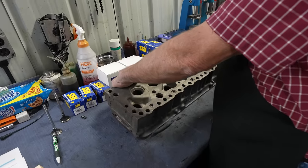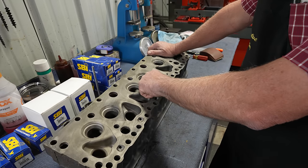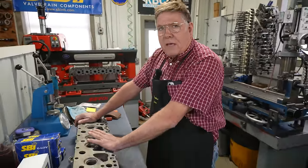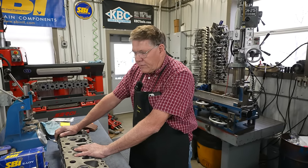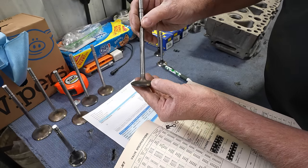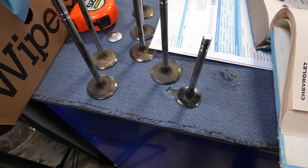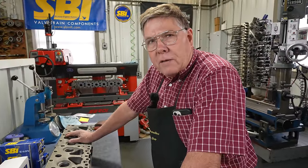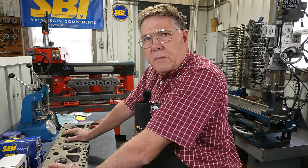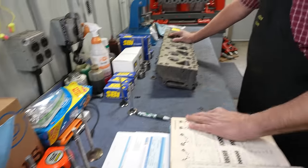This head had very recently had all the valve guides replaced and had one intake that actually seized up. Trying to figure out why that happened, we checked the clearances and I feel like maybe they fit the guides just a little bit too tight or had some tight spots. Looking at the valves — these were all brand new SBI valves — every one of the intake valves has a spot where it's blued from excessive heat. In my opinion, they must have had something going on with timing or a fuel issue causing excessive combustion temperature, which may have contributed to the valve problem.